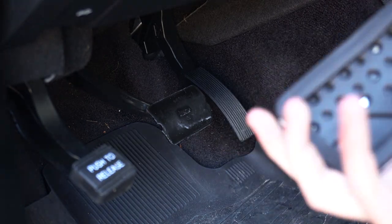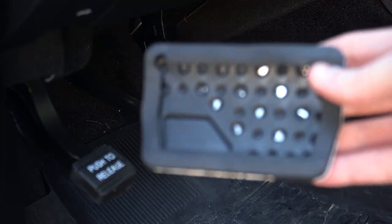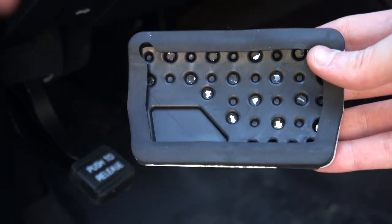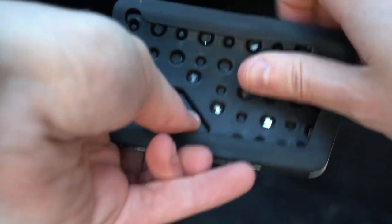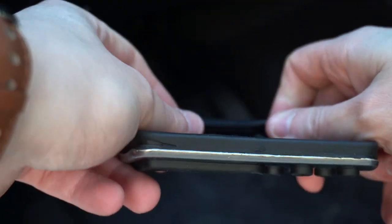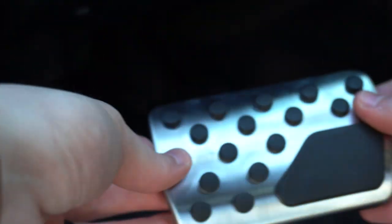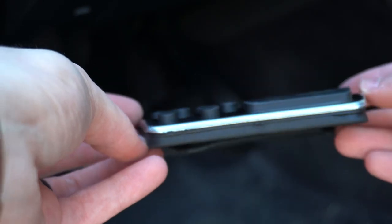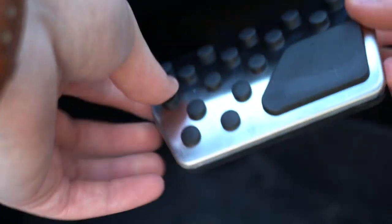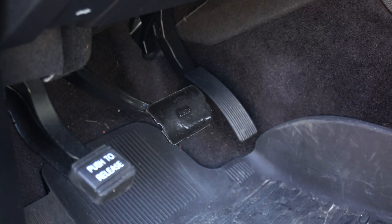For the brake it's going to be kind of a pain because it has this nice rubber lip on the back. It does have this rubber lip so we're gonna have to get that to stretch around, and right now it's pretty cold out so it's not gonna be too pliable. We're gonna go ahead and put this in a bowl with some really hot water, basically almost boiling, for a few minutes so it should hopefully loosen up. But let's go ahead and pop the gas pedal cover on first and then we'll see how that looks.